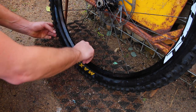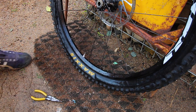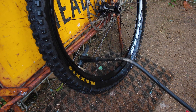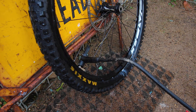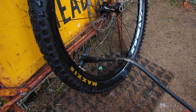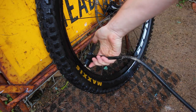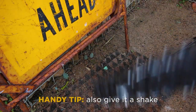Just grab your valve core and stick it back in, tighten that up with your pliers again. Make sure it's open and then pump the tire up again. To avoid too much seepage, just turn your valve over to the side a little bit and start pumping. I generally make sure I've over-pumped a little bit just to make sure we get a good seal. Make sure you swirl the sealant around to seal the bead nicely. That's the front done - rinse and repeat for the other one.